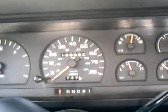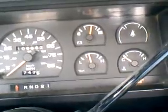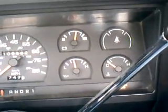Now mind you, this thing has been sitting since probably mid-October. I have not driven it. She's real shaky — she's got a bad lifter and probably a stuck valve. You can hear it clicking away. You can see that the oil pressure's pretty low, on the low side of normal. Normally on a cold start it should be toward the middle or high. Voltage looks good. That's the nice thing about this little truck — it's got a full gauge package. Let's just let it idle for a bit.